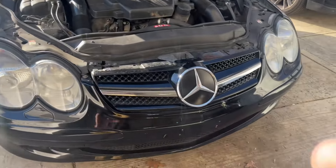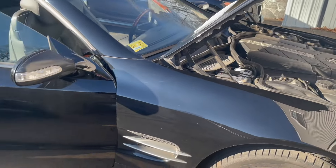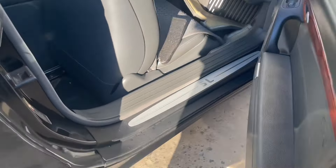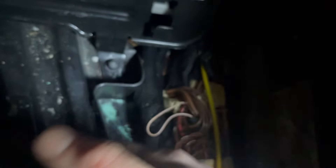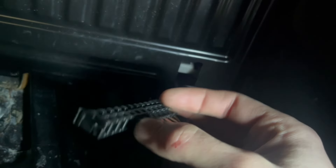Back from the car wash. I've ripped apart the car to try to figure out this electrical issue — I believe it's a CAN issue. I checked the back and that was fine, but then I got to the front and there is a corroded CAN terminal. When I was taking the carpet apart I noticed it's a little damp in there. Once I picked this up and started messing with it, you can actually hear the chime — stuff is starting to work again. The doors finally went down because it sees that the doors are open. So I think this is going to be the issue, and I'm going to see if I can clean this up or find a replacement terminal.